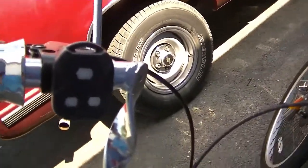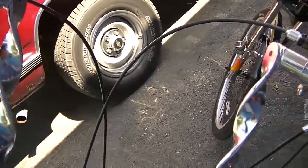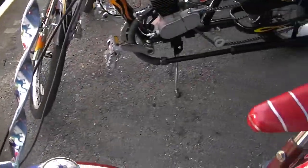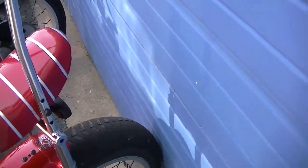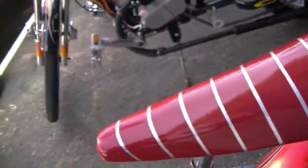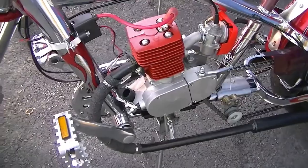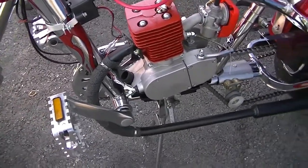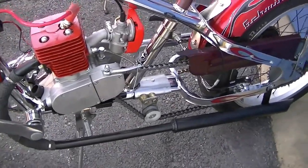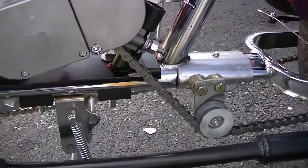These bikes all have working headlamps. This is a Bluetooth-operated blinker setup — you can see which way it's flashing without hearing a clicking noise, which you can't hear anyway since these bikes are fairly loud. Loud pipe saves lives. The brake light is right there, very visible. If you're riding at night you'll have a very easy-to-see rear blinker. I also heat wrap the pipes in that area to preserve them, prevent burns, as that's the hottest part of the pipe. This is a custom exhaust made for the OCC Schwinn Stingray bikes.